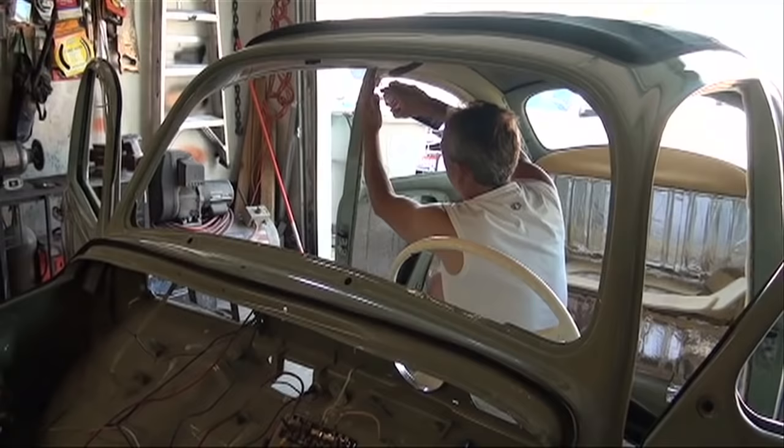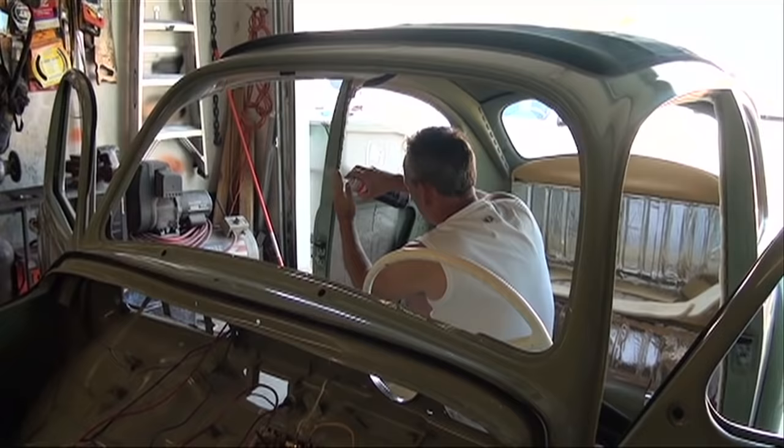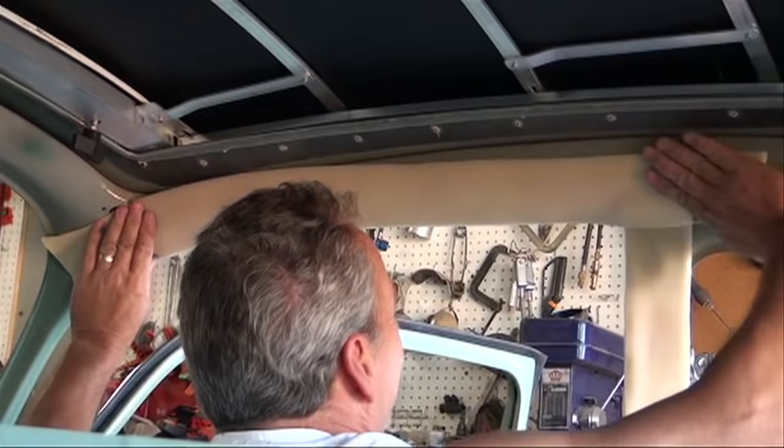This evening, I managed to install the padding kit for the headliner. Once we cleaned the bug off and sandblasted the interior, we removed all the existing padding. There's an online reseller that sells the padding kit. Unfortunately, it doesn't come with a lot of instructions on where the pad goes and how to fasten it to the car. So through trial and error, we found a good headliner adhesive, and it stuck fairly well, and I think it'll be a good addition to the headliner once it's installed.